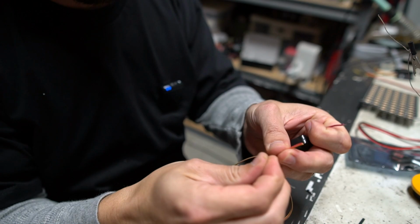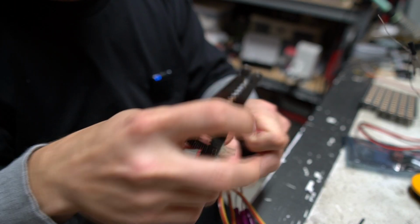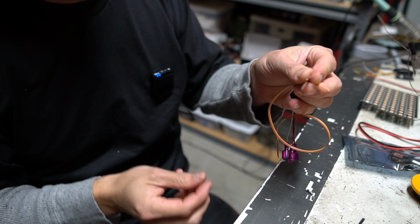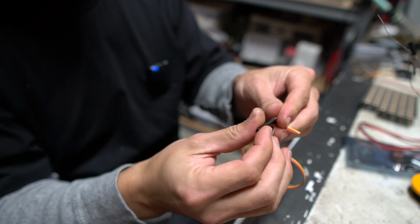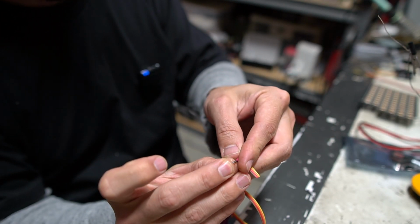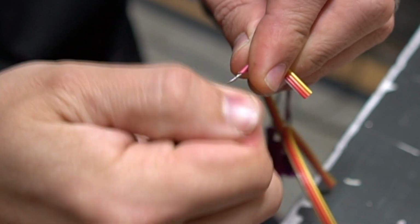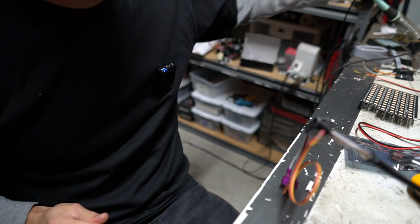Now, to be fair, let's show a good example of like a 26 gauge wire and then I guess a 22 gauge wire. Let's just say that we wanted to do the same idea with heat shrink as the other, but do the twist and fold over method. Then you just take the 2 pieces of wire, aim them up to where the stripped shielding starts at about the same spot, twist them together, and then solder them.